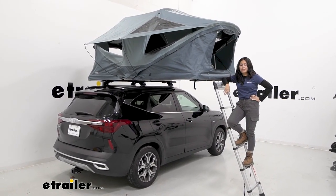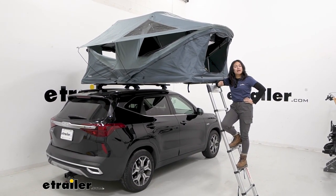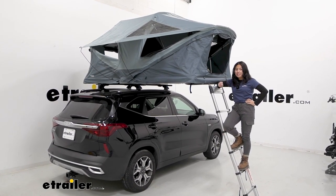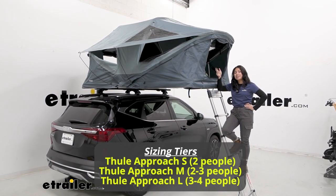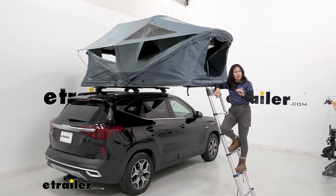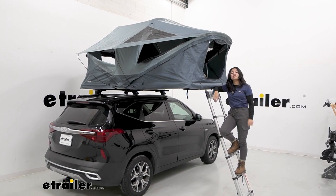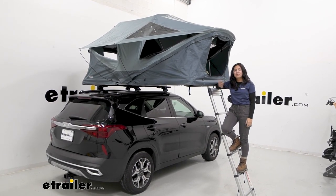When we put this on the roof, I noticed this was a very hefty rooftop tent — there were three of us carrying it onto the crossbars. So be mindful of your roof weight and crossbar weight capacity. We recommend a minimum crossbar capacity of 165 pounds, because the small tent is already 110 pounds, the medium is 128 pounds, and the large is 150 pounds. That weight is for your dynamic weight capacity — meaning you're moving with cargo on top. Once you're parked and stopped with the ladder in the support position, you enter the static weight capacity, which is 600 pounds for this tent.